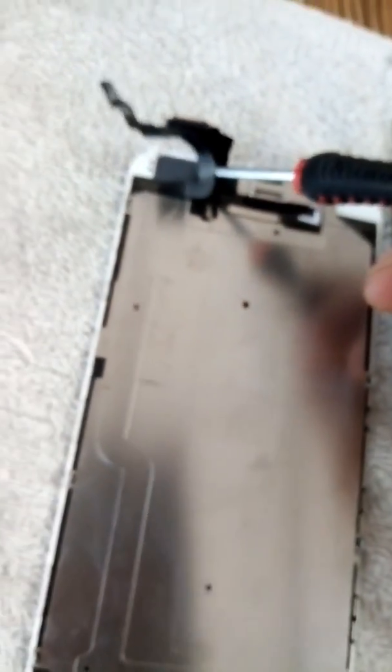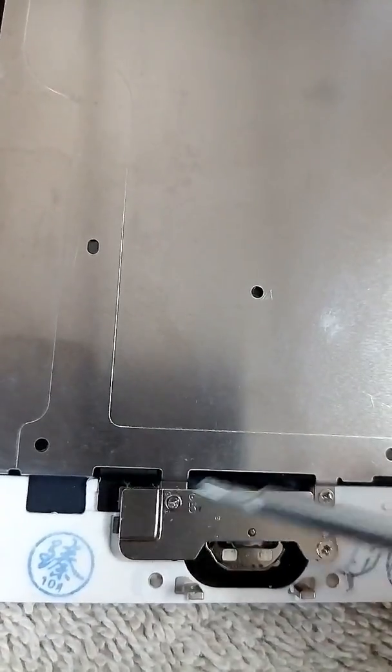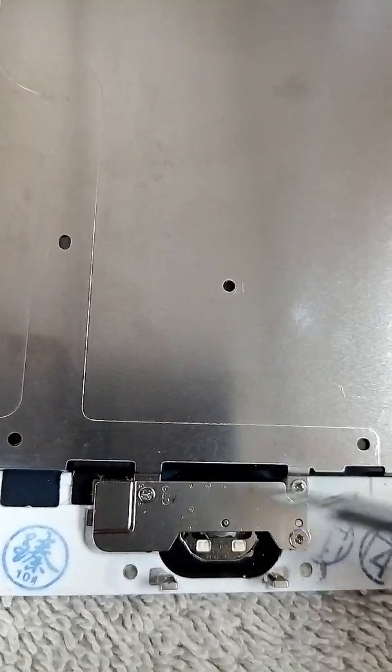You can pull up on it once you're taking the old one out. Don't pull up on it on your new one. Once you change it, put all the screws back. Start by hooking your fingerprint button back up carefully — it just clips in — then secure it down with this screw, this screw, and your metal plate.